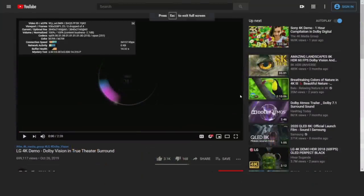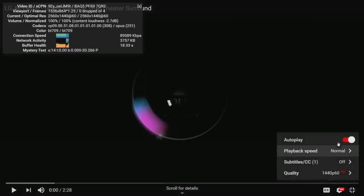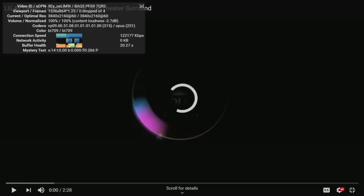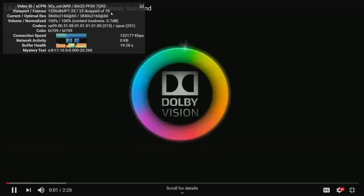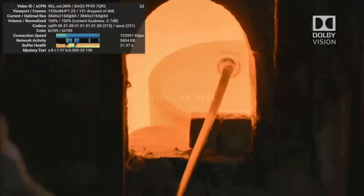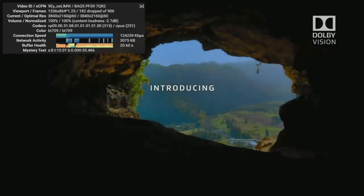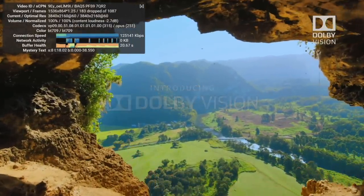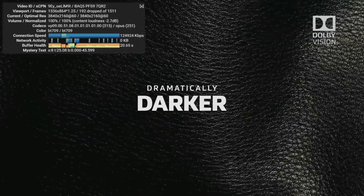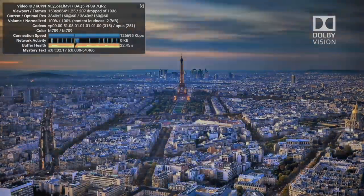I've moved over to YouTube to test 4K video streaming. Going full screen with stats for nerds on, making sure we're at 4K. You'll see we're getting a lot of dropped frames here with this 4K video, and this was definitely not the case with the LarkBox Pro. Not exactly sure what's going on, since it's the same CPU — it might come down to power management and how the CPU clocks with different applications. Since there are other devices with the same CPU at the same or lower price that perform better, this is a bit discouraging.